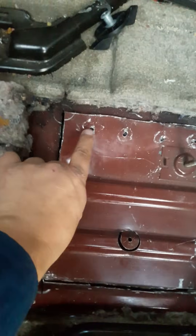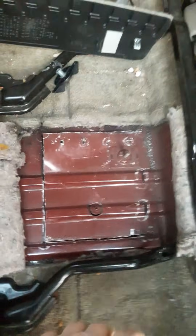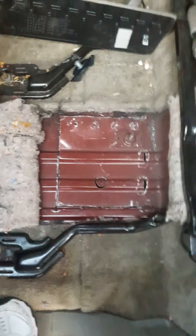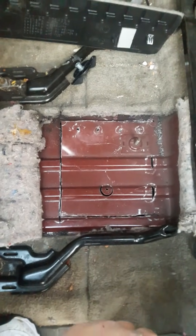The spot welds were here, here, and here. I didn't drill all the way through — just enough to manipulate the metal and pop it up. The good thing about not removing the plate all the way is that I could fold it up and push it back down when done. Use a sheet metal screw here, here, and here — maybe just two — and it'll hold it down. Then use gorilla tape or adhesive tape, not duct tape because it won't stick well. I fold the fabric back down, flip my seat, and I'm pretty much done. This is a 2000 GMC Yukon — I'm not speaking for any other vehicles. Hopefully this helps with your fuel pump.